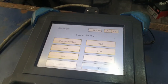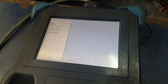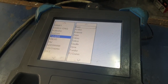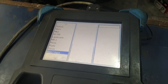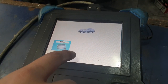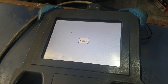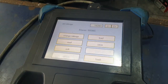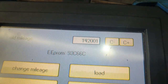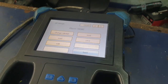We're going to go back to the main menu and select Toyota, then Prius, and C66 again so that we can read the EEPROM again and press Program. Here you can see the mileage that we input has been written on the EEPROM — the mileage has been changed successfully. Now you can go back and start to disassemble everything.